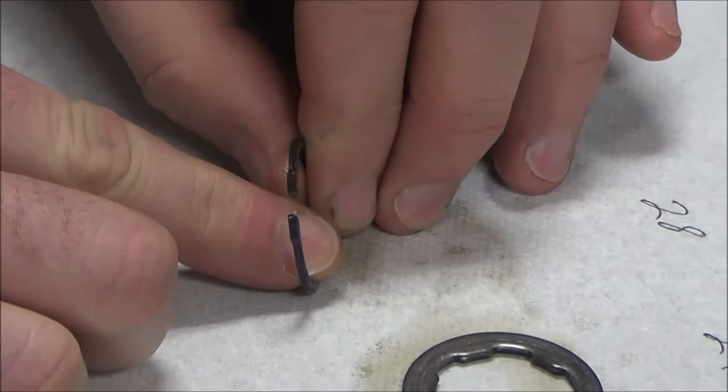Due to the physical size of this gear — it's probably first or second gear, one that gets heavily abused — here's what I talked about earlier, the bronze insert. Did it have plenty of oil? Oh yeah, it's still got its color to it. When they're bad they'll be black, just burnt up. If it didn't have any oil, it probably wouldn't have these little divots or holes that retain the oil. They'll be completely smoked off.